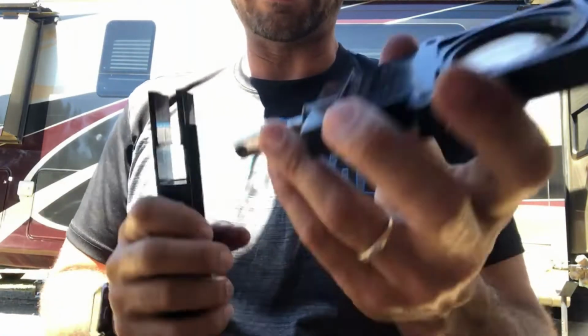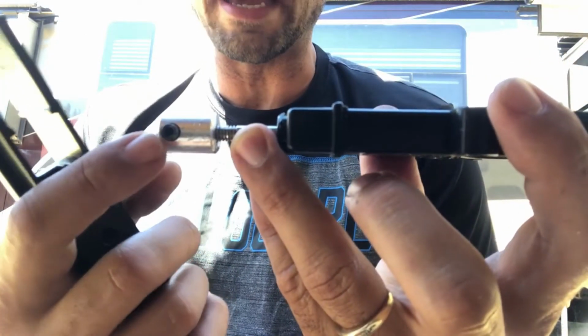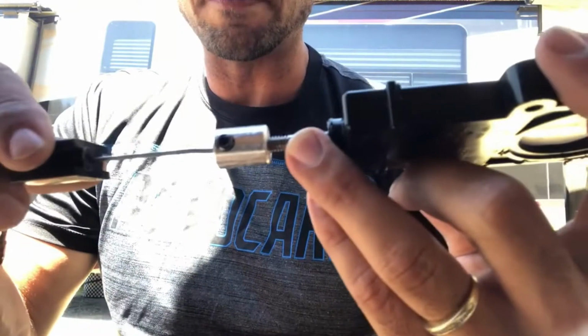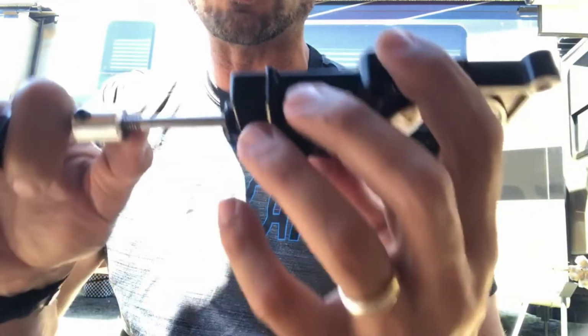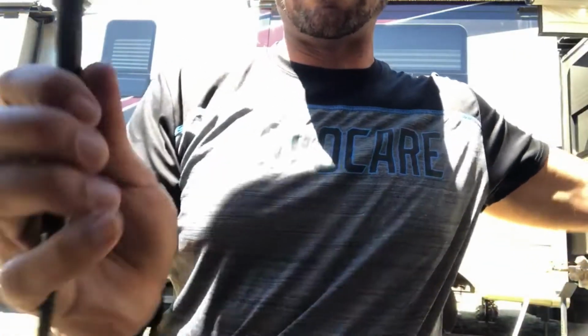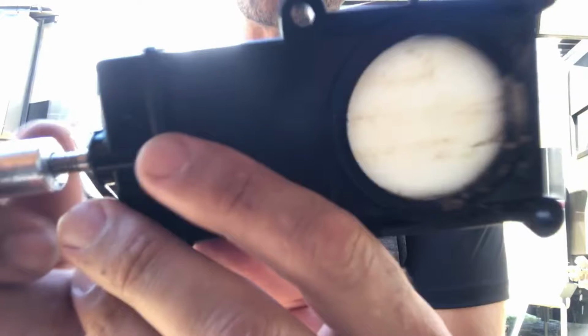Okay, that'll slide out, and then you'll see this little Allen thing that was holding that cable. That was holding this cable in here. There's a little tiny hole here, and you turned that nut earlier and you released it, and so that comes out of there. So this whole thing was what was activating this gray valve with the cable. Sometimes this cable fails, or sometimes this stem on this end bends and we're unable to use this. Okay, so now we're upgrading to the auto drain.